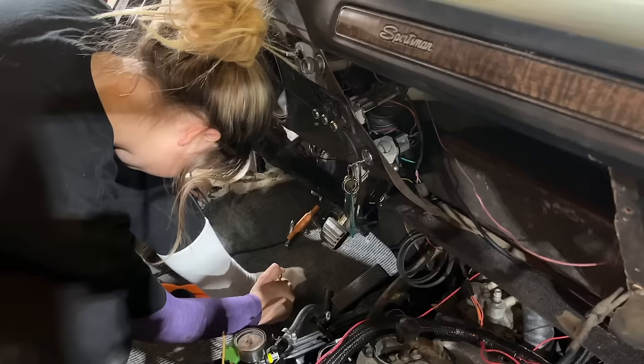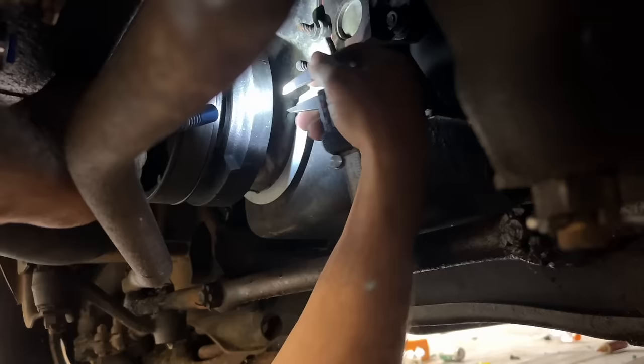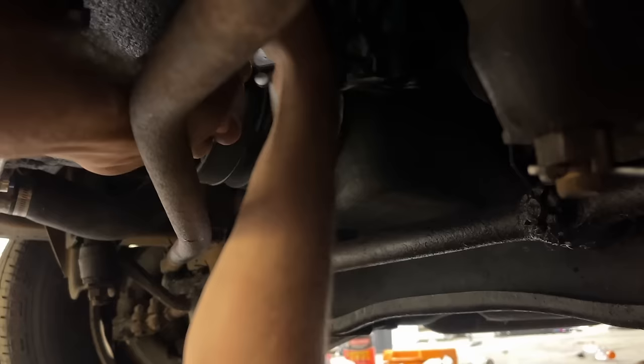Tell me if you feel anything on your thumb. Pressure coming out. Right there? Yep. Okay. So that's 20 degrees. This is 30 degrees. And I measured the distance between them. 40 degrees is right at the C. And 50 degrees is right there. So this is where we need this thing to be lined up at, on our marker up here at zero.